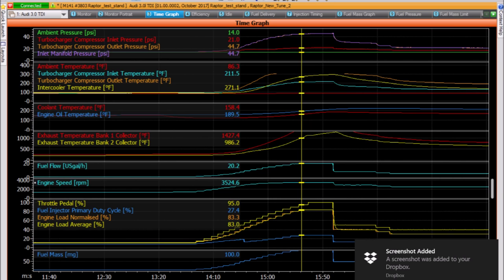What's probably more accurate is what a cruise power setting will look like. During the ramp up to that same run, the engine RPM is at 2,848 and boost is at 22 psi — admittedly still warming up, so exhaust temperatures of 417 and 314 coming out of turbo 1 and turbo 2 are still building. But at 2,800 RPM it's burning 7.8 gallons an hour, which is basically what I've been projecting all along. At cruise power around seven and a half gallons an hour, that should be enough to run comfortably and hopefully true out at 230 knots at 25,000 feet, which would be about 160 knots indicated at that altitude.